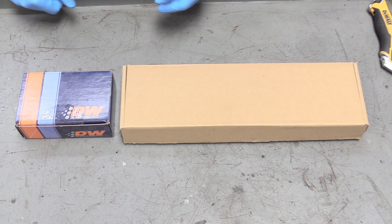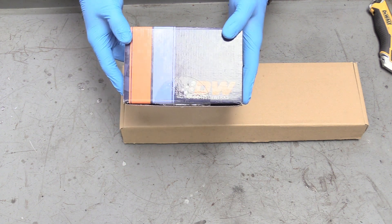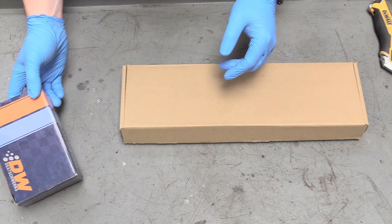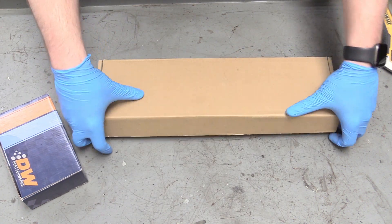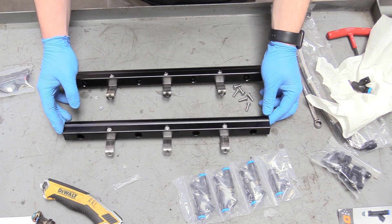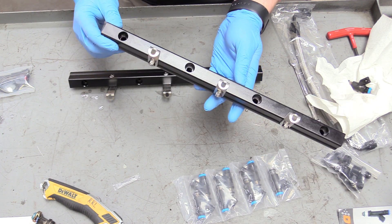The next thing we're going to go on to is our fuel delivery, accomplished with these DW fuel injectors — a high performance fuel injector. You could get away with using stock, but for a performance application you'd want a more powerful fuel injector to let more fuel in and make more power. These were sent over by Summit Racing. We also have a Summit Racing fuel rail system — our fuel injectors go in here and then onto our intake manifold. Before we put any injectors in, make sure the inside is all nice and clean. You could put some carburetor spray in there and some compressed air to make sure there are no metal chips in there.